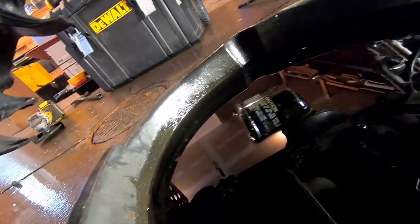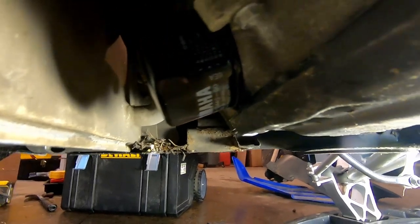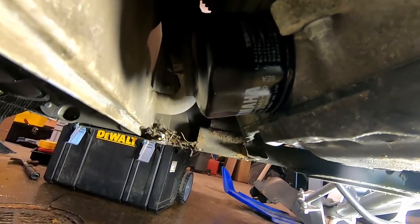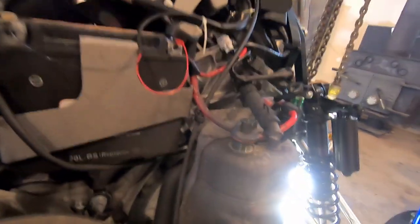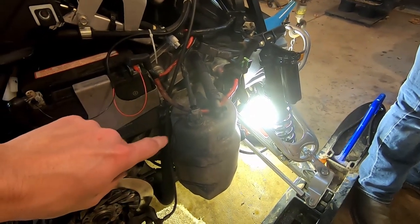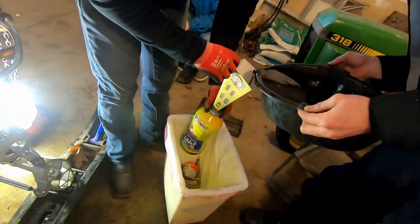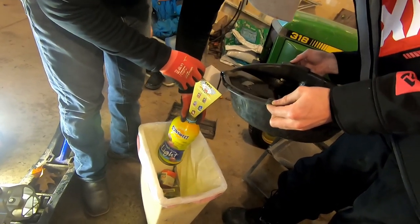So that's where the oil filter is. Took it off, drained the oil out — I actually dropped it in there, don't do that. Now we're going to get the new oil filter and throw it on. Go ahead and get your oil filter on there. Take a little bit of oil, lubricate the ring on top, and get it on there hand tight. You can use an oil filter tightener but it's not necessary — just get it hand tight and you'll be good. Make sure your drain plug is tightened, then go ahead and throw oil in her. You're going to put 3.38 quarts into this. I only put in three — I'm going to take it outside and run it, then put the last 0.38 quarts in. Make sure you dispose of your oil appropriately — put it in another container and any auto parts store will let you turn in recycled oil.